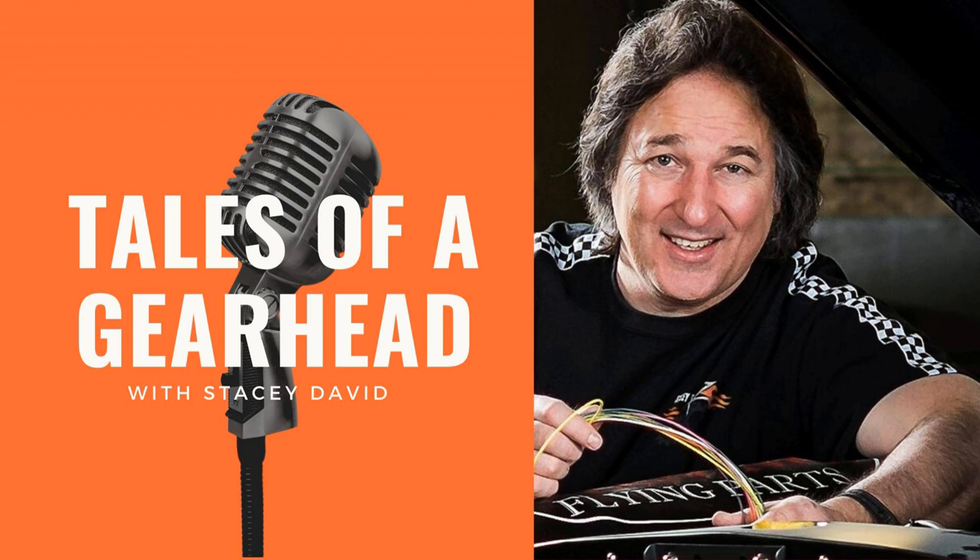If you can't find somebody to do that for you, I'd suggest getting another cab. Those '67-'72 cabs are so valuable — you could easily sell it to somebody like me; I'd buy a cab like that in a second because I can get it cheap and it's not that hard for me to straighten. But for someone without the tools and ability, it can be a nightmare. Don't let somebody just shim it up — once you start shimming, you have to shim everything: the body on the frame, the front fenders, the doors. You want to straighten the thing back up.